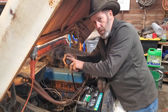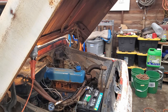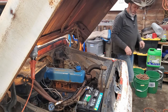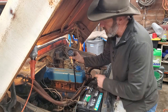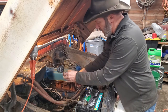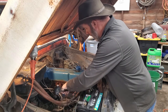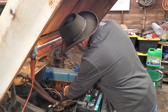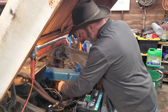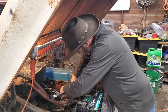I'm going to crank it over, and if we've got compression it's going to build up. Let's hold it and see what we have. Good mechanics would have a remote starter and wouldn't have to run back and forth. We're at about 100 pounds of compression. I did that dry — 100 pounds dry — meaning that cylinder wall is not lubricated and the engine hasn't been running. I want a more accurate representation, so I'm going to put about three squirts of oil right down into the cylinder. Oil acts as a sealant as well as a lubricant, and let's see if I get any different results.